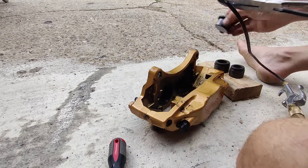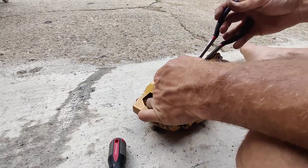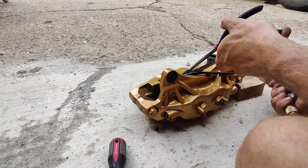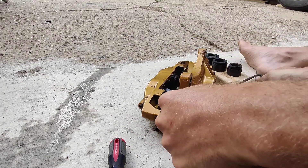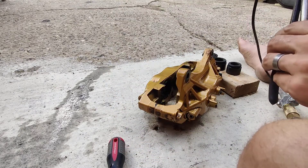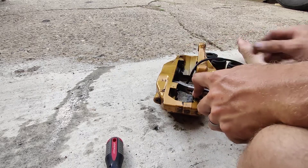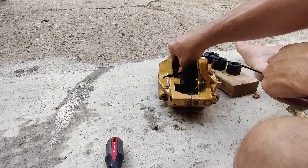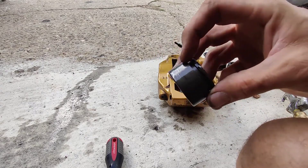I can hold that tip down to the next piston and go one by one, shooting them up. So you don't have to twist them or get marks all over them with your pliers — you just gotta get the end of that little plastic piece into the next hole and they'll come out one by one. Last one. Just gotta find the hole, and it doesn't leave any marks — less marks than trying to grab them out with a pair of vise grips.